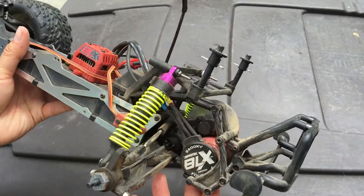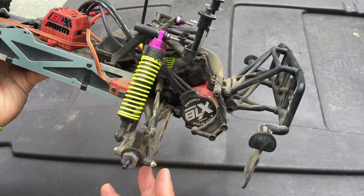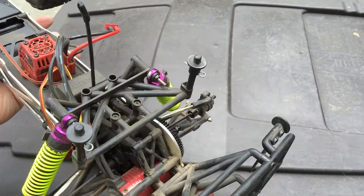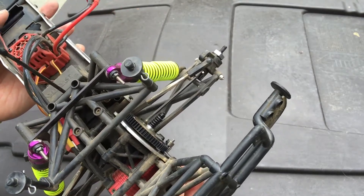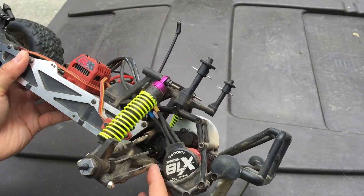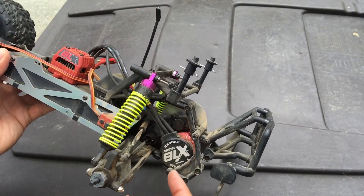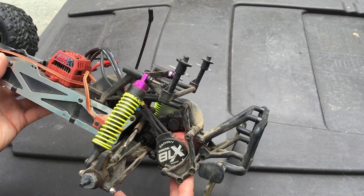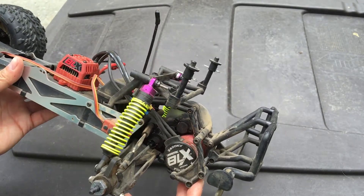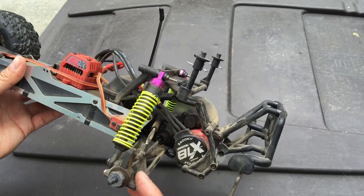We have had some problems with this truck, however — specifically with the differentials. Right now the car isn't running and it's in a half-disassembled state because we need to tear into the gearbox again. This is a known issue; if you research it on the Arma forums, it's an ongoing problem with some of these trucks — the durability of the gears in the differential. We had torn it down once already and nothing seemed wrong, but things got worse after reassembly: it started making gnashing and clunking noises, and right now it's just failed altogether.